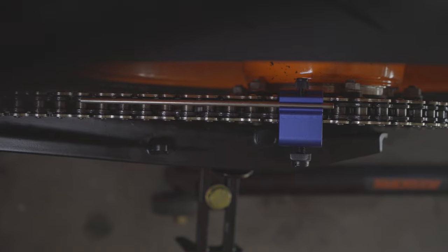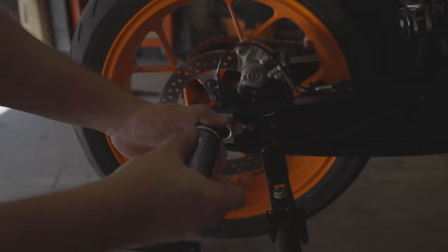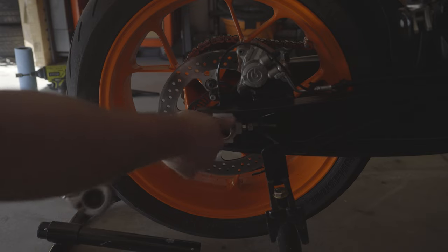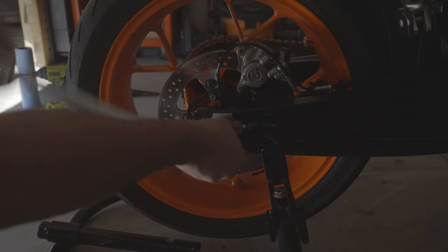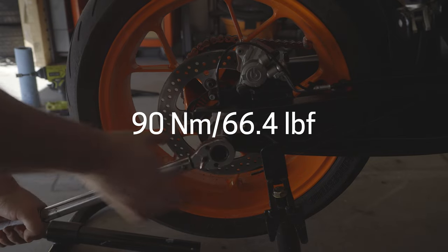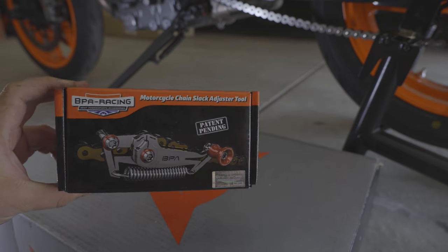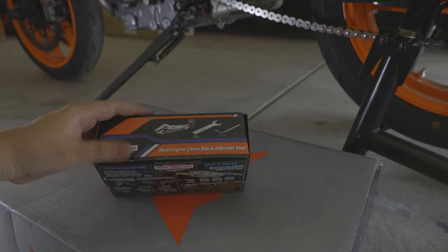I have a lot to say about that in future videos, though I haven't gotten a lot of time to ride. The usability with the quick shifter has been vastly improved. So we're going to grab our 32 millimeter and obviously snug that axle back up to spec — I'll put that on the screen here. It's not a fun process, but you can cut down on this process by using a tool like a chain slack adjuster. If you're looking out for that, definitely make sure you're subscribed, drop a like if this helped you, and go ahead and recommend whatever DIYs you'd like to see next. Thanks, everyone.